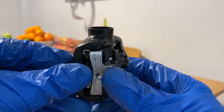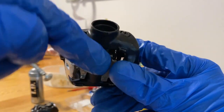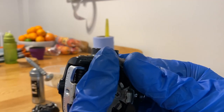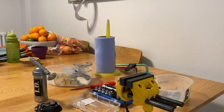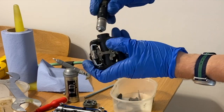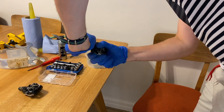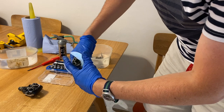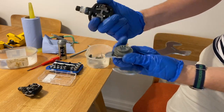Another factor of the genius of SPD design is you don't need to pack the actual bearing assembly with grease at all - this thing does it automatically. All you do is fill this cylinder down the middle of the body about a quarter to a third full of white grease, and then when you screw the assembly in it forces the grease up through the bearings and out of the collar at the top, filling it with grease, sealing it, and making it run beautifully smoothly. You can hear the excess grease popping out through the top seal - very satisfying. You don't need to rip it up tight because it is only a plastic collar - just pinch it till it's snug, take off the tool, and hey presto. Give that a wipe and this thing is as new.